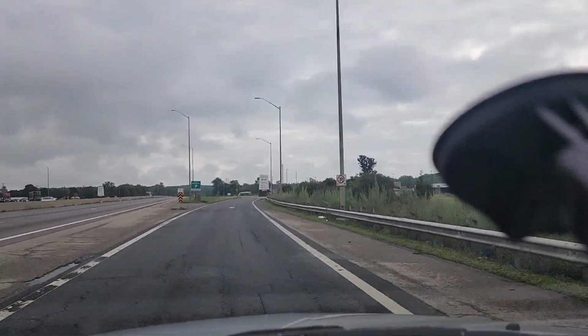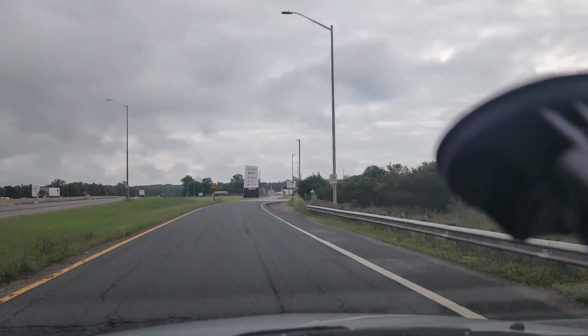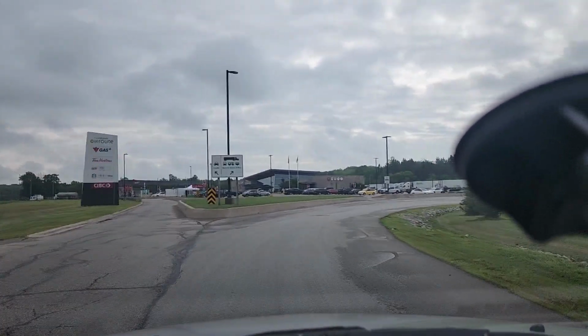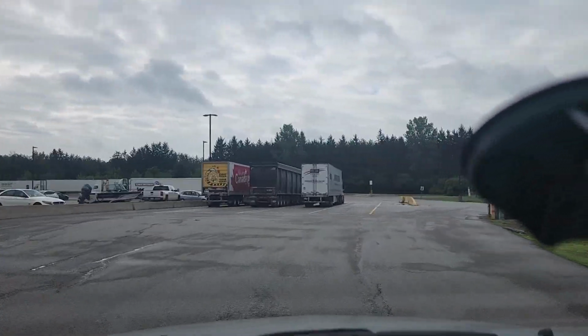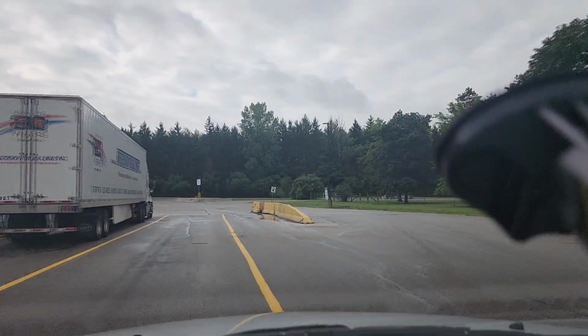Okay, so I'm just pulling into an on-road here. I was doing some quick looking here. We're gonna do the math and all this stuff once I get home, but I can tell by the sheet that there's probably about 600 pounds of tongue weight on the car right now, which is too much. You know, there should only be about 350.